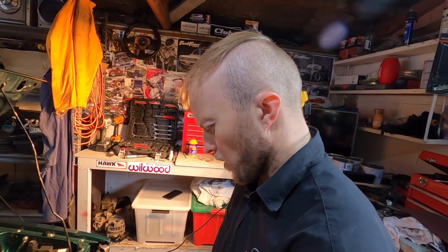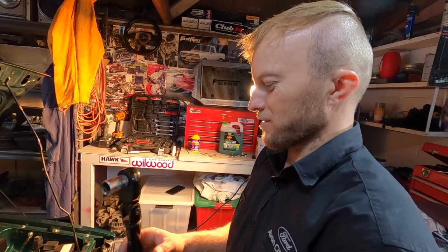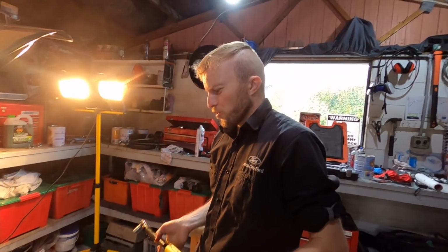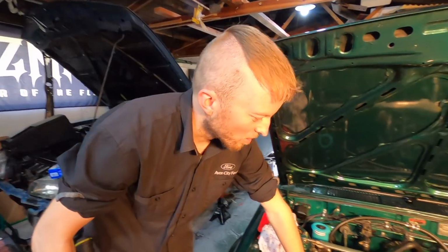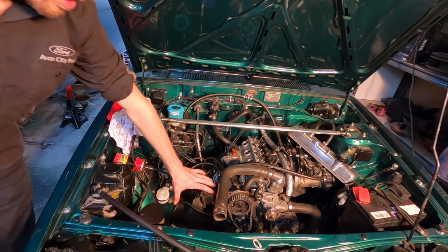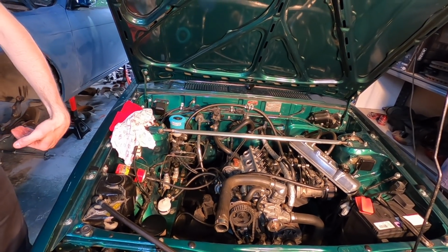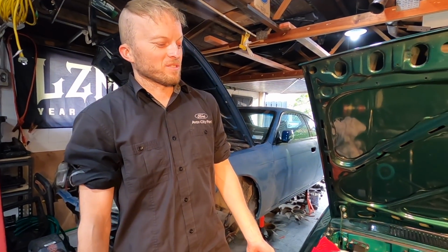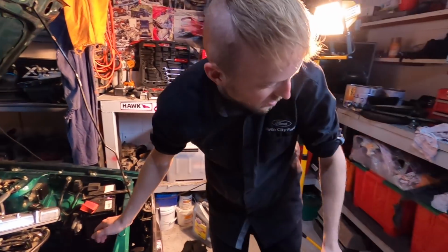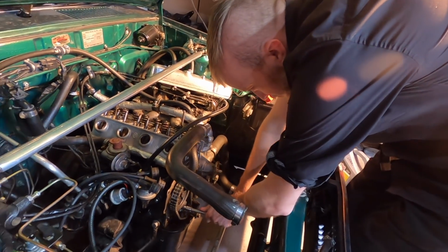So the torque setting for the cam belt is between 40 and 47 foot-pounds. So I'm going to go 40, because I'm scared. Tighten that gear down first before putting the tensioner on, because now it's like cocked. Or will it just drive itself home? What do you mean? I just finger tightened the belt. Yeah, so the tension is not fully on the dowel properly, and now the tensioner is on, it's tensioning the chain, which has cocked the pulley a bit. Oh, I get you. Ideally you probably should take the tensioner off. It's going to take 2 seconds, so you may as well. Yeah, because we have struck so many issues so far.